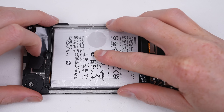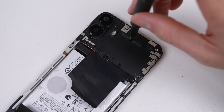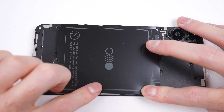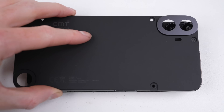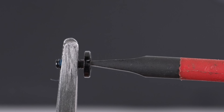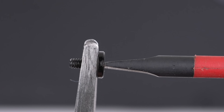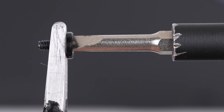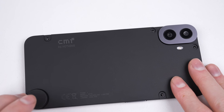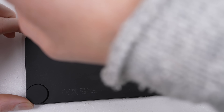I'll get the battery installed using its original adhesive, as it's still plenty strong enough, before attaching the upper antenna. Then it's just a case of reapplying the plastic barrier over the battery before wiping away any dirt and fingerprints before attaching the back panel. The slotted screws used to secure the back panel don't appear to be a standard size — no flathead driver I had fit correctly, and the smaller drivers that did fit weren't wide enough. Nothing does show a screwdriver on their website, which presumably comes with purchased accessories — maybe that driver works better.